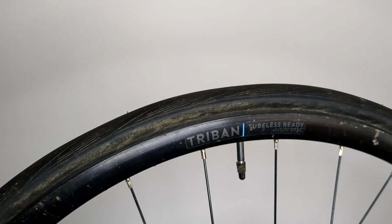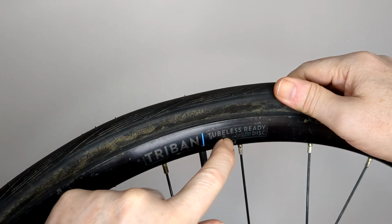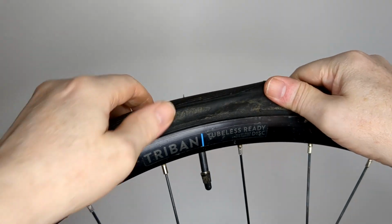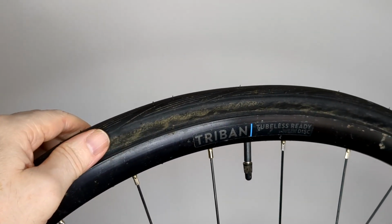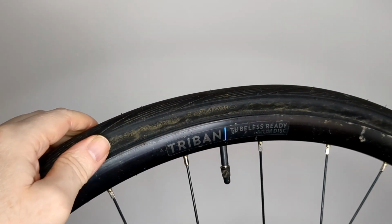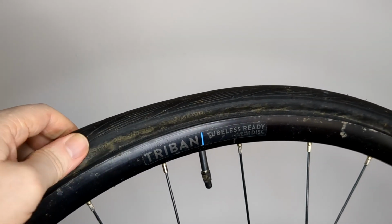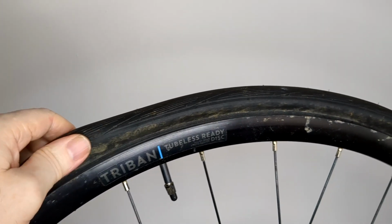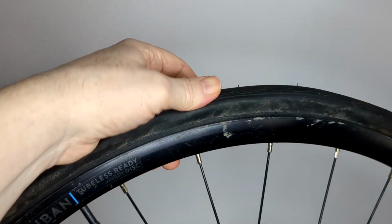Absolutely beautiful. Yeah, so to Joe Public I say, if you've not tried tubeless ready wheels before, remember they're a lot tighter and on at least one side there's a good chance it'll stick. You'll know it because when you're pumping up the wheel you'll hear a ping, which a tubeless tyre person will go into a state of euphoria over, because it means it's really sealed in at the side, the bead. But for us that use an inner tube, it's probably a sign of depression and future problems. It's sort of catching in there or something.